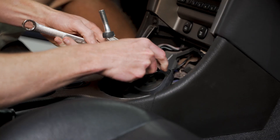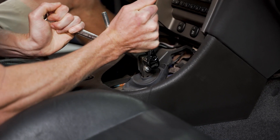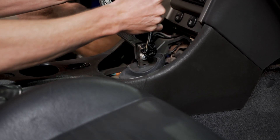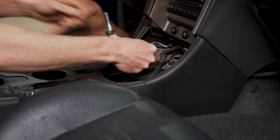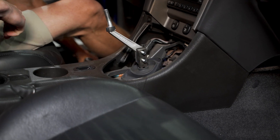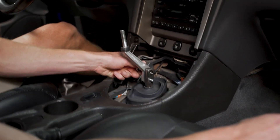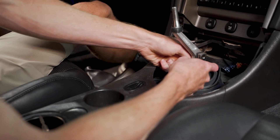I'm going to go ahead and break this free. Hardware with aftermarket stuff will always differ, so I won't quote that. There may be blue thread locking compound in place, so just be mindful that these may come loose in an abrupt manner. We got those broke loose — go ahead and back these nuts off and set them aside. The lever is threaded; somebody just added nuts for an extra layer of clamping force.